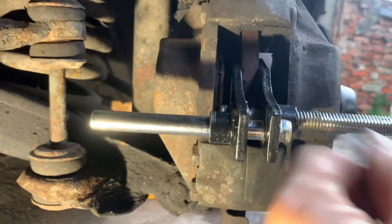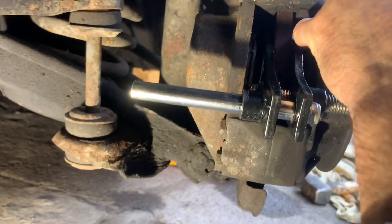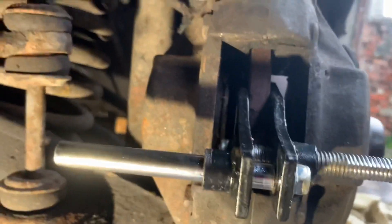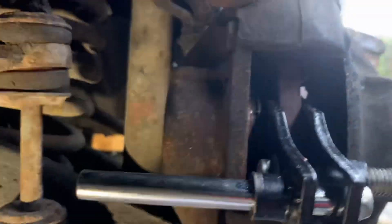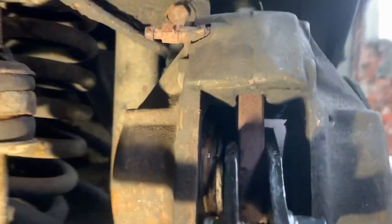I'm going to tighten this up to see if I can force those pistons out and get a little bit of movement. We might be able to get a tiny dab of grease on the outside of the piston casing, but you've got to be pretty careful around brakes — you don't want any grease on the actual brake surfaces. Ideally when you squeeze the brakes those calipers should spring back, but I suspect they're not going to. We have the culprit: that piston on one side is springing back, but this one on the other side is not.